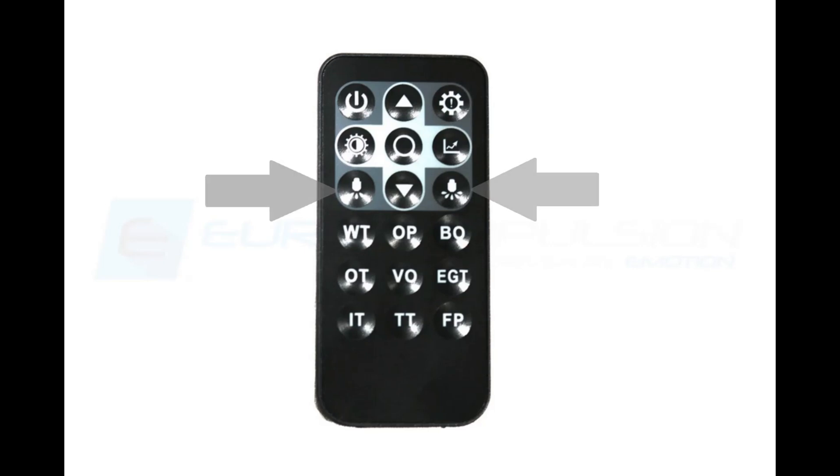Next, I repeat this process for the high spray button. As an example, I might set the system to start spraying at 10 psi of boost, at which point it will spray a reduced amount of fluid. Then I have it set to go to maximum spray at 15 psi or whatever. This works very well as it allows you to spray quite a bit without bogging the engine down with too much spray too soon.